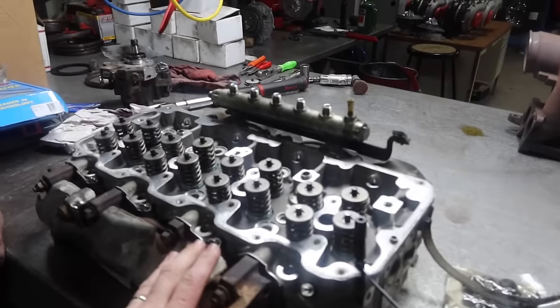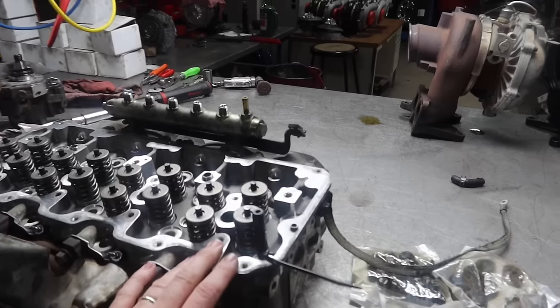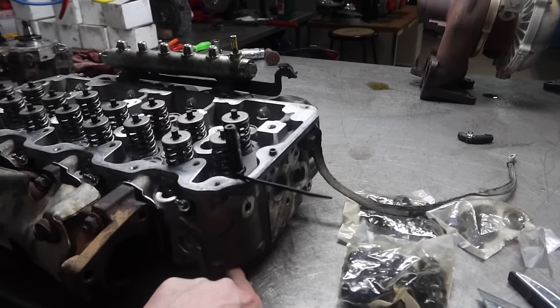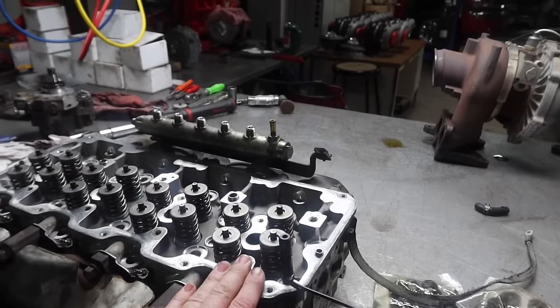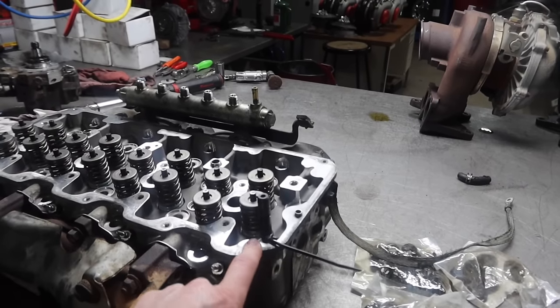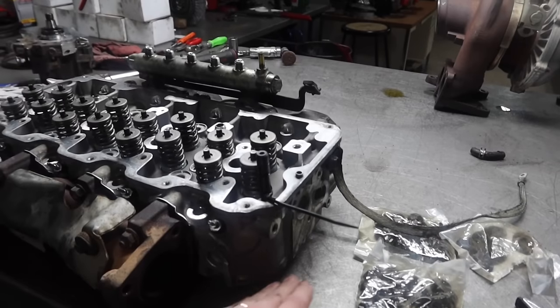So you guys remember when we removed the head on the driver's side? Now, obviously, you're not going to be able to remove it once we set that head. So what we're going to go ahead and do is just put a zip tie here, only because we're going to keep it elevated to where the lower part of the block right here is going to remain flush. It's a lot easier because right when you set this head on the driver's side, you're not going to be able to put this last stud in. So just go ahead and pregame it, guys. Make sure that there's a zip tie here. Just keep it elevated so it's not completely hitting the motor once you set it down, but it's already ready to go.